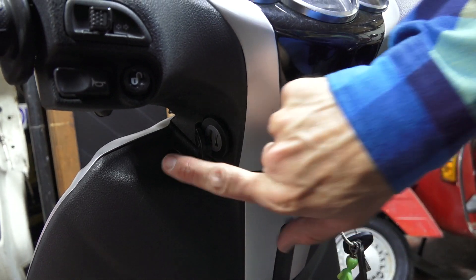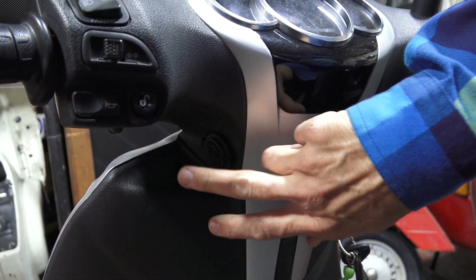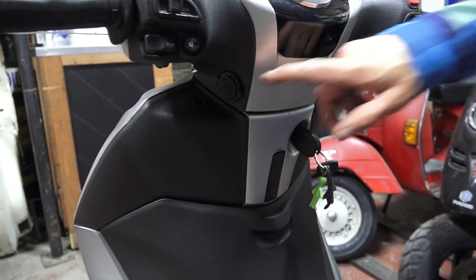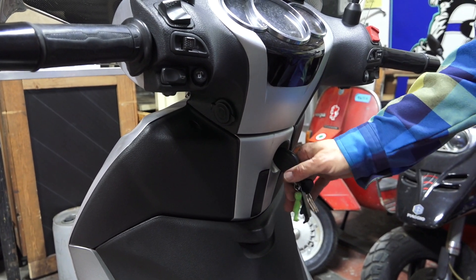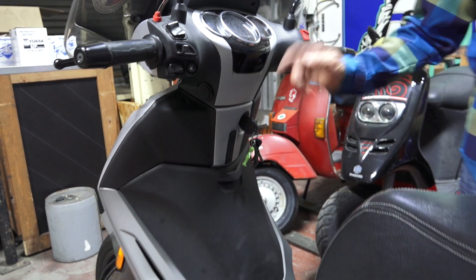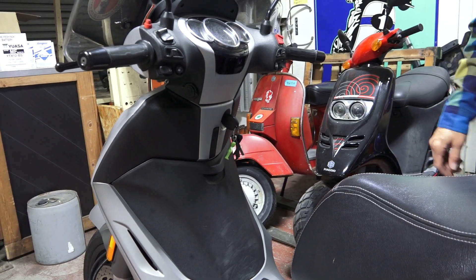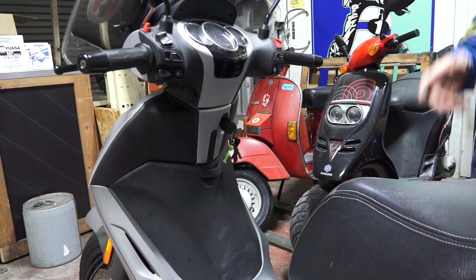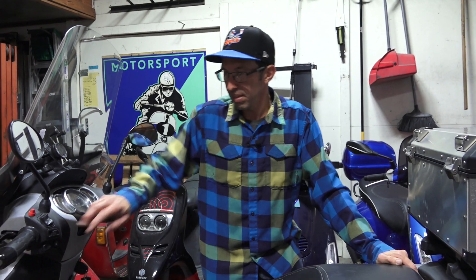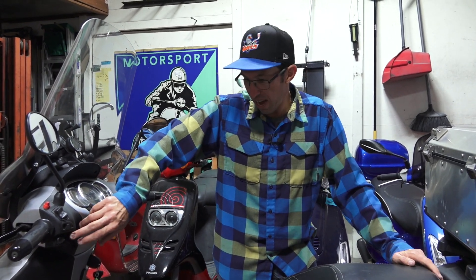As you can see it just went off — I have a timer so it runs both the Baja Designs fog lights and the cigarette lighter a little bit longer, for about another minute after I turn the key off. I like that feature: I can turn the engine off, pull up to my garage, and still have light. It took some extra nerd-out with some electronics to make the little module that does that. I don't sell that on our web store.